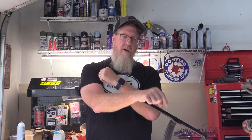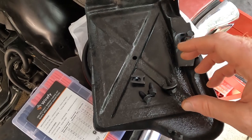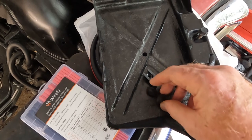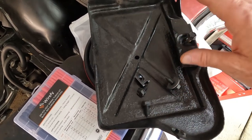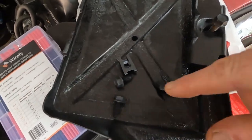I've got to get a new battery tray installed, then I can put my battery in and see pretty much where I need to have that new positive cable. I want to run the cable along behind the inner fender and down along the firewall to the starter. Before I jump on this, I will say: if you take anything apart, make sure you keep track of your bolts. I actually had to order all three of these new battery tray bolts because I did not keep track of them, lost them, and had to spend more in shipping than it costs for the bolts.